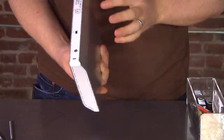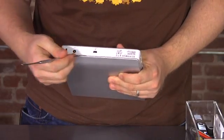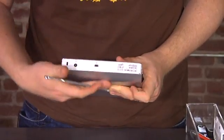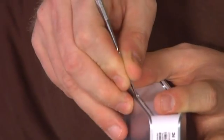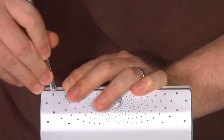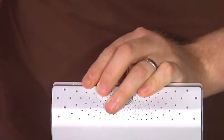I've never taken one of these apart before. My normal trick of looking for the feet with the screws underneath doesn't apply because there are no feet on this thing. If I had to guess, the circuit board — because of the way the USB port is put on here — is probably at the bottom. The good thing about this one is that I don't care if the drive cage gets messed up because it doesn't work. So all the normal rules about gouging and forcing and using metal spudgers instead of plastic ones — yeah, forget all that stuff. We're going to get our destruction on.